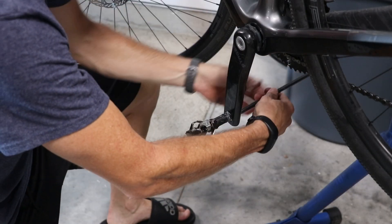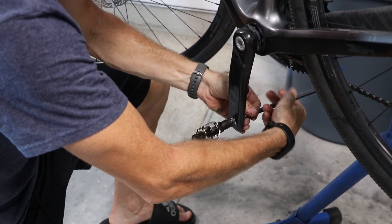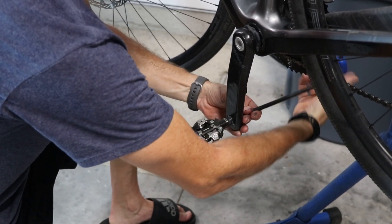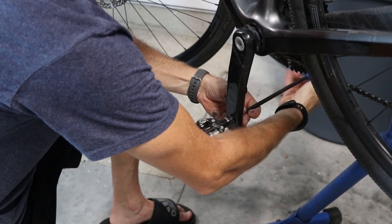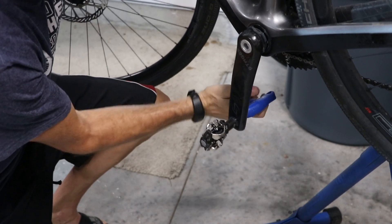The very last thing we'll do is put the pedal on. In case you don't know, a left pedal is a reverse thread whereas a right pedal is a normal thread. Do not tighten your pedal crazy tight — it's one of the most over-tightened components on a bicycle. So that is how you put a Stages power meter on a bike that has a spindle attached to the non-drive side crank arm. After I get some ride time on this power meter, I'll post a follow-up review and show how it connects to my Garmin — I'll be using mainly the Garmin Edge 1030, since that's what I use on the gravel bike. Questions or comments about this video or the Stages power meter, drop those below. Thanks for watching.